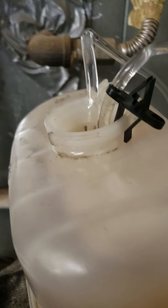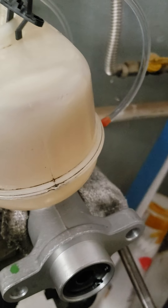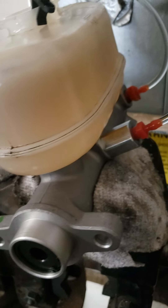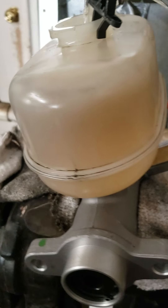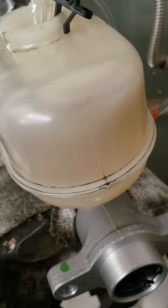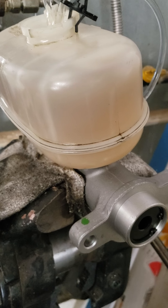Then add all your new brake fluid. I prefer to use full synthetic brake fluid. This master cylinder is on an RV and sits right next to the exhaust manifold — it has a small heat shield, but brake fluid eventually breaks down like any oil with heat, so synthetics just last longer. I prefer the Amsoil synthetic, but you can use whatever you want.